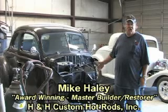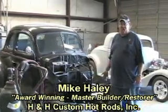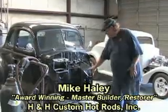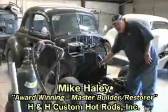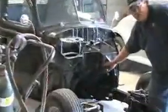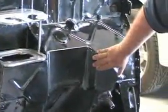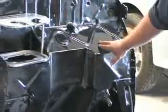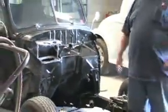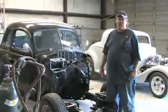This particular car is a 1940 Ford Deluxe, where we removed the straight axle from underneath it and put in a Mustang 2 front suspension. We also replaced the firewall from halfway down, clear down and underneath the seat, and we finished this job out with Rust Bullet's Black Shell. That's the product name, and that's not paint, that's just Black Shell on this car. It'll never rust again. It seals and kills all rust. We don't feel any job's complete without it.